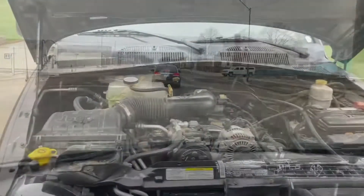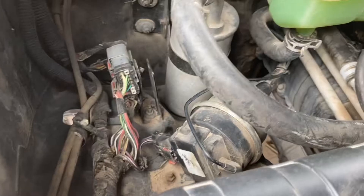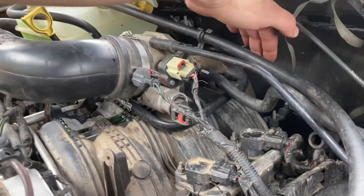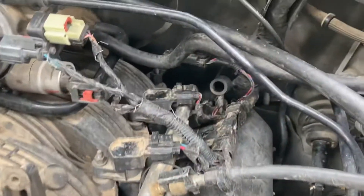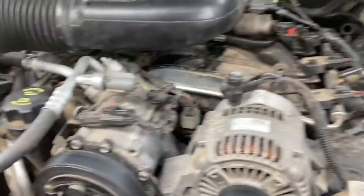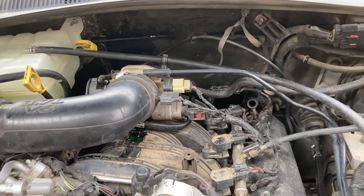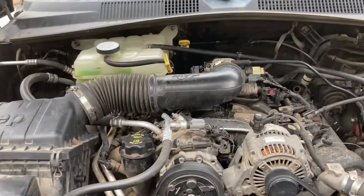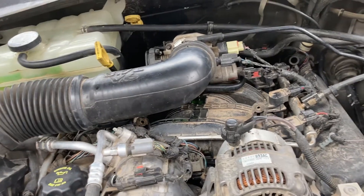Back at the house now. One of the issues was the vacuum booster got unplugged because a vacuum line was hooked up in the wrong place — it had been run down to the valve covers, but on both sides those lines actually need to go to the booster. There's some coolant still up on the intake because those heater core hoses had both clamps off and it blew one of them off. Outside of that, everything else seems to be running really good — a couple of minor issues still to work out.